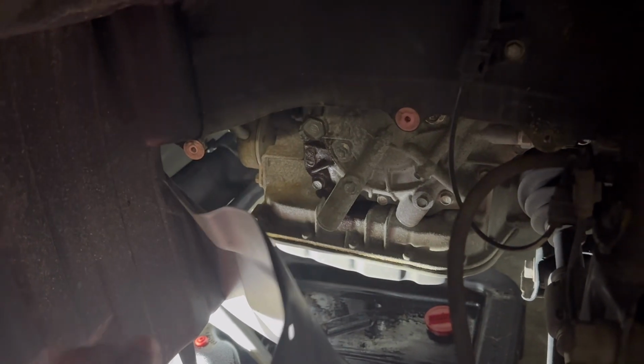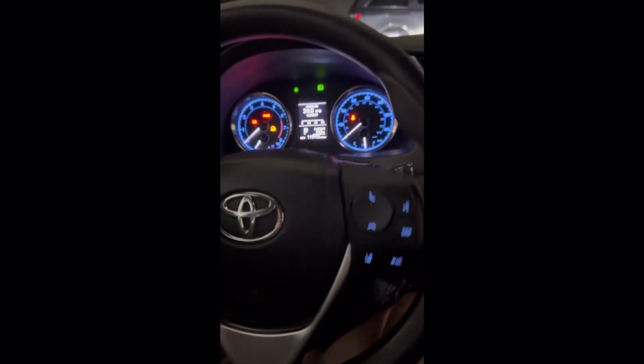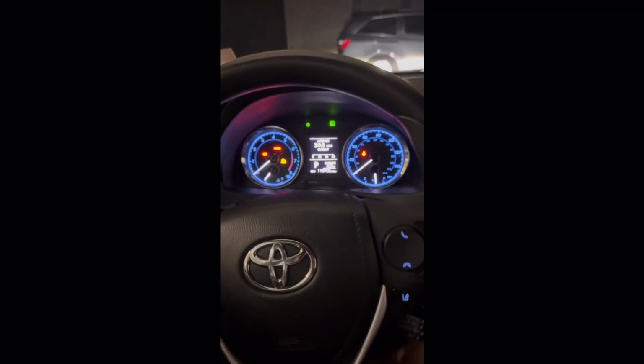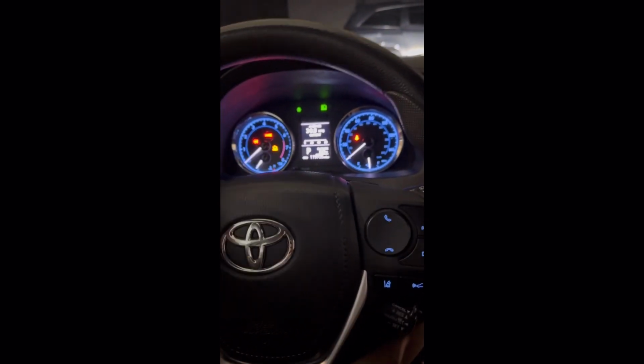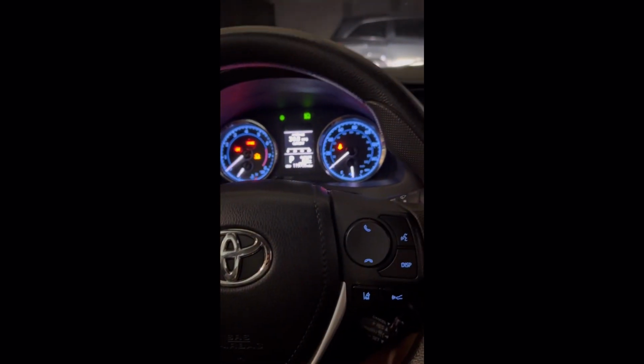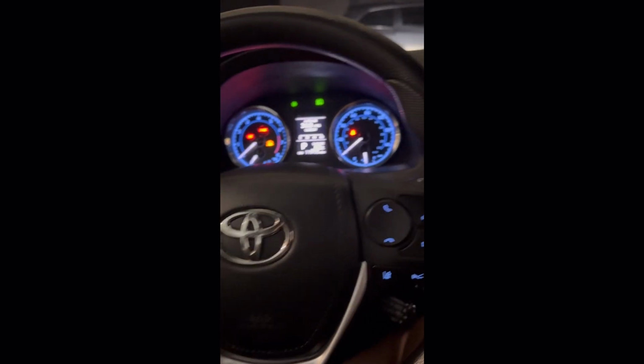I guess I'll see you guys next time after I put this wheel back on. All right, you can see we have put the wheel back on, torqued it to 76 foot-pounds. Not just throwing the ugga-duggas to it, but done the thing right, okay?